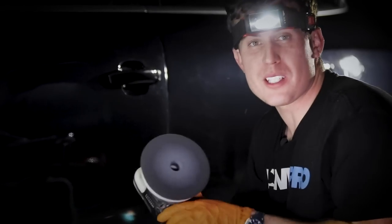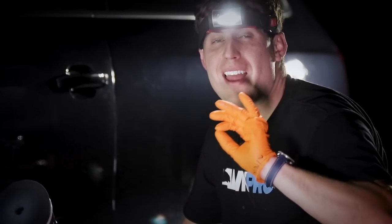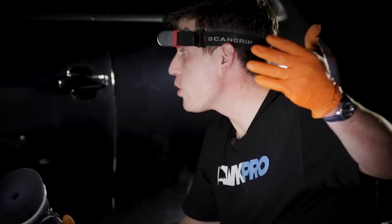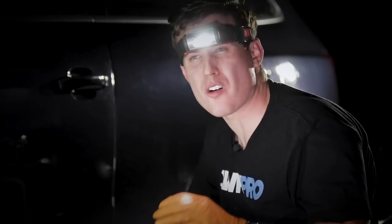The clarity you get with this method, the speed 6, a little bit of pressure, super slow, is insane. It will work every time. I was just blown away by the fact that I could push this stuff around with fast arm movements, get around a black car that I'd spent so many hours compounding. It used to take me twice as long to polish it out. If you've done those overnighters, if you're in those trenches, you guys, I really highly recommend trying this method.